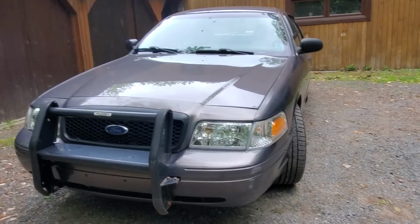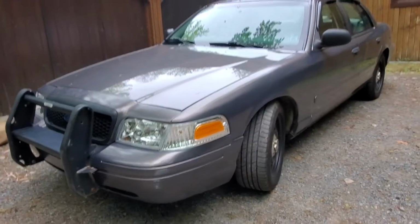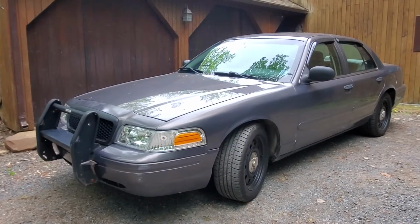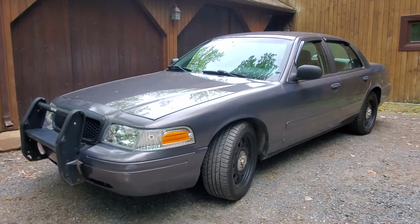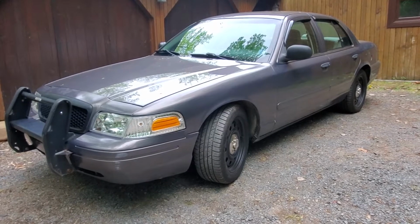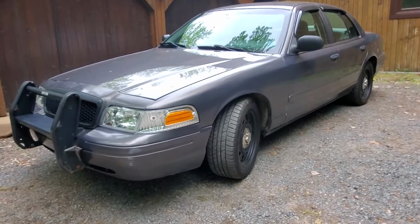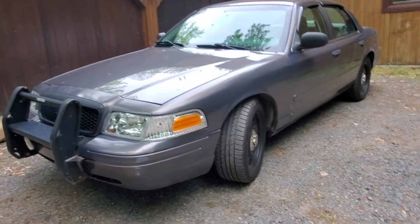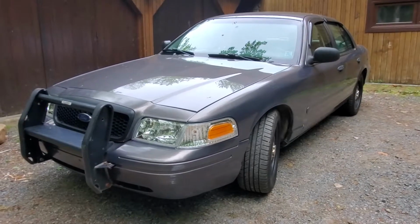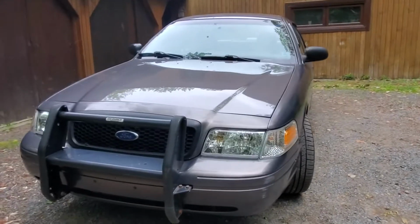It likes to hold on to that third gear for a long time before the torque lockout kicks in and shifts the car on you. So I find for driving around, you'd probably get the best gas mileage on average with the Lincoln Town Car. But with the 273s and even the Lincoln Town Car, I think you can still expect about 19 to 21 miles per gallon average mix between sitting and driving. When you move, it just depends on how much highway driving you do and whatnot. With highway only driving, I would definitely suggest getting a car with the 273 gears, because you could definitely get yourself 26, 27 miles per gallon. Usually no problem, as long as you don't drive crazy.